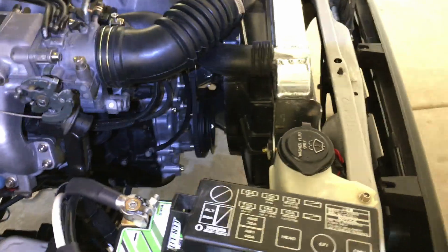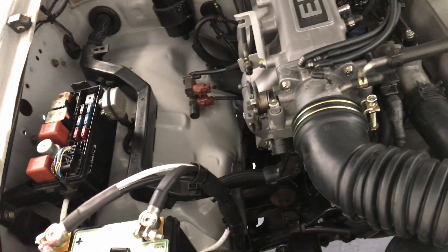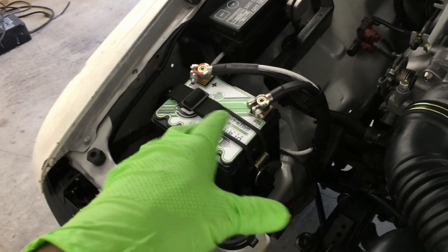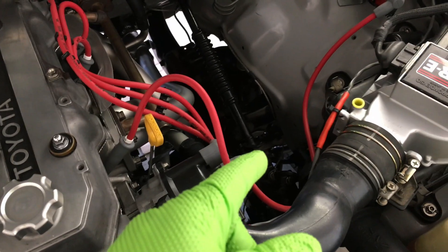That gives me a little backup protection for some of these circuits. So if I'm out on the road and something goes haywire, I can always reset — like the fan, for example. If the fan overheats, it'll trip that 40 amp breaker before it melts anything. The same applies because I'm running a lithium-ion battery: there's a danger that if the battery were totally depleted and I fired up the motor,